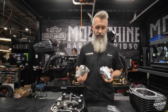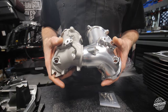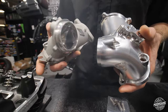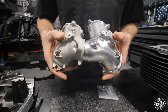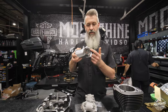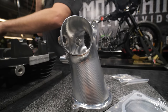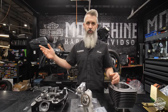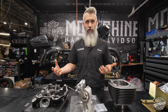The square port has a lot more cross-sectional area. If you look, I can put the Harley-Davidson round port — we're putting the outside diameter inside of our port — that's how much more surface area or cross-sectional area is in this port. We typically go to a Monster Series setup like this when we're going to 135 and larger cubic inch M8 engines, because it's just requiring more air in.